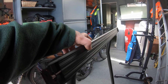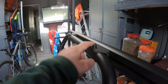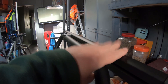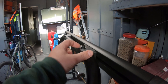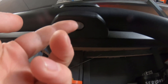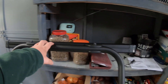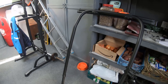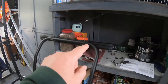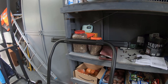This is the bottom bar, which is also going to be glued onto the van. It's bolted through with coach bolts, and these go on in a specific direction — if you tighten it and it's spinning, you've got it the wrong way round. There is a square nut hole on one side, whereas the other side is round, so just flip it over if you get it wrong. I'm going to dry fit this to the van first to make sure everything's okay before applying Sikaflex and gluing it in place.